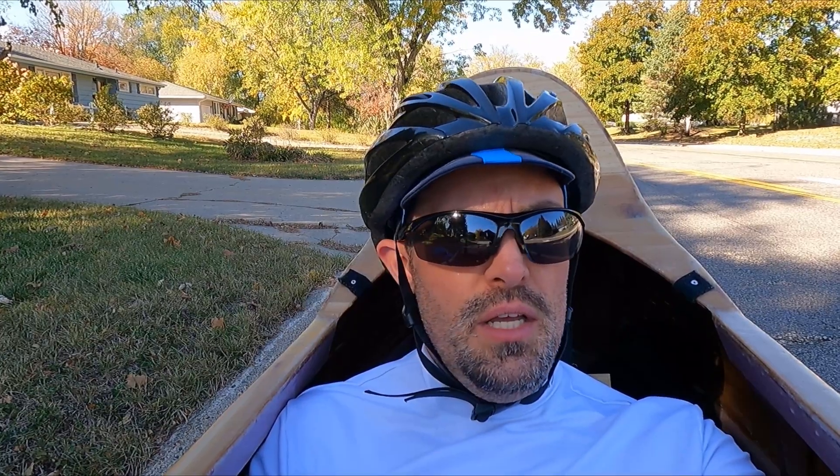I tried one run without the race hood and I think one run is sufficient for that. Compared to the three runs before it with the race hood, I was a little bit slower and the wattage was up quite a bit. So the race hood makes a difference at least at higher speeds. I'm not going to test any more today because one, I'm supposed to be working right now, and two, I'm exhausted. I think I have something that's slowing me down someplace — possibly an issue with the wheels or their orientation. I need to flip it over and see how well squared up things are. The problem is I built the sides and the top first and then added the bottom in later. That was a mistake.